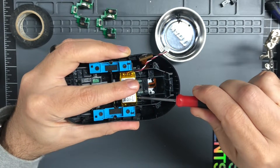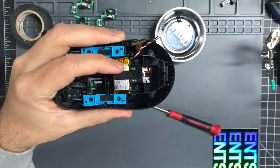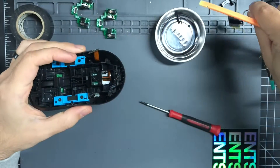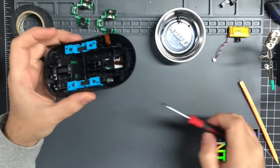So under here the battery is just glued in. I don't really love the screwdriver for this — use a spudger if you have it, or like a plastic fork or something, a plastic knife. Leave the adhesive side up and make sure it doesn't get dirty. And then the next set is the four screws to get the clicks out.